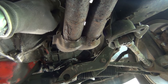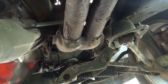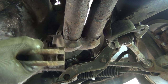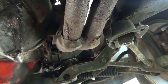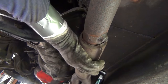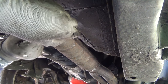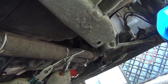Let's get on with fixing some of the issues I've been talking about earlier in the video. I have to try to somehow fasten the metal sheets around the exhaust pipes. I had originally planned to use ordinary hose clamps, but I just don't have clamps that are big enough, and they also wouldn't really fit around the sheets because they are not exactly circular. So what I ended up doing is drilling some additional holes with a power drill into the sheets, cutting some slits so that they would bend together under pressure, and then inserting some pieces of steel wire and clamping it together with an ordinary rope clamp. I use these parts not because they are a great solution but because I had them lying around for years anyway.